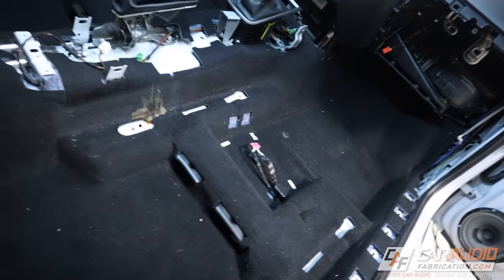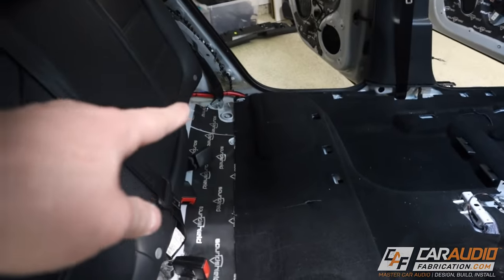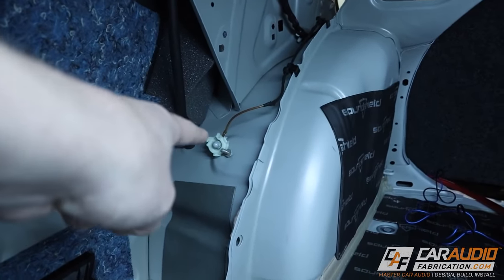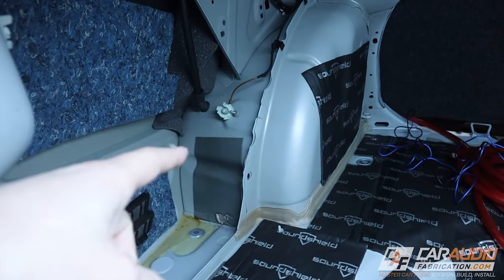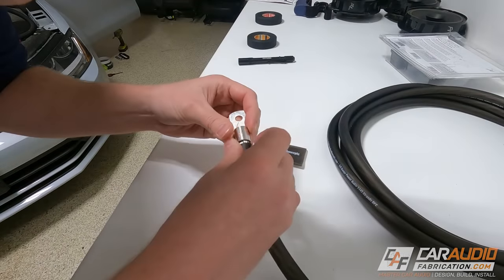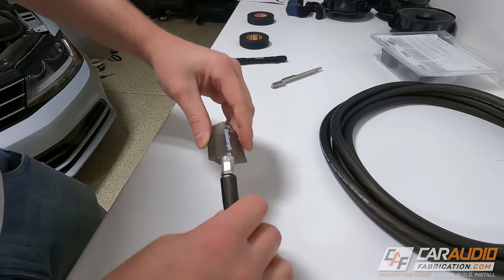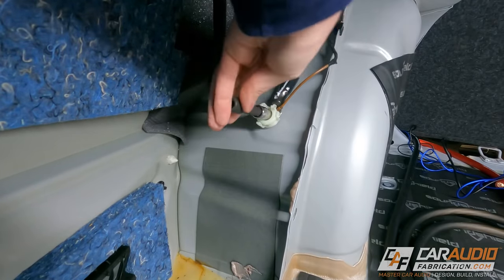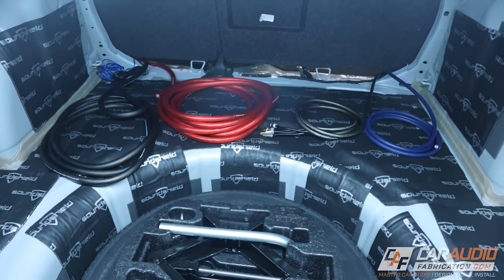Signal and speaker wire are now ran on this side, and the carpet is back in the vehicle. I can start adding the trim on the sides. I've got the wires secured on each side going into the trunk. The last connection I need to add in the trunk is to add a ground. I measured this factory ground location and it measured less than 0.1 ohm of resistance all the way up to the front of the vehicle — so definitely a good ground. I strip away the insulation and use a crimp terminal from New Concepts in my hydraulic crimper. I crimp it down for a really nice crimp, apply the heat shrink and heat shrink it up. Back in the trunk I connect the ground wire to the factory ground location using that OEM nut. With that, all the wires in the back of the trunk are ready for the next stage of the project.